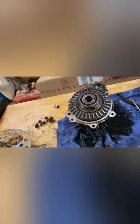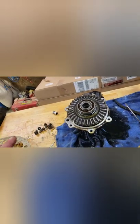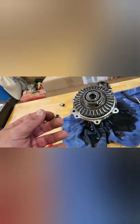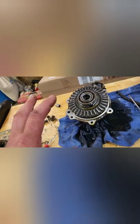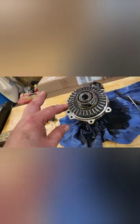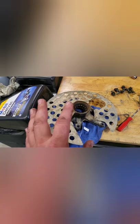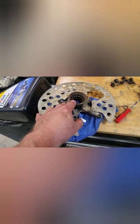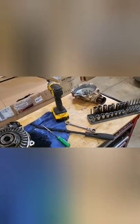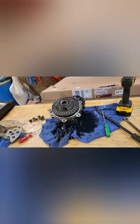The front right wheel, which is this output side, is also the one that's directly connected to the pinion at all times — meaning if that wheel's spinning, the front propeller shaft is spinning coming out of the transmission. I think the next thing I've got to check is to see if maybe it was stuck like in four-wheel drive because a shift fork bent, or if there's something actually inside the transmission of the four-wheeler that's hosed, or if it's just as simple as these wheel bearings. There's a part of me that fears this is becoming far more complicated than just a simple differential rebuild.